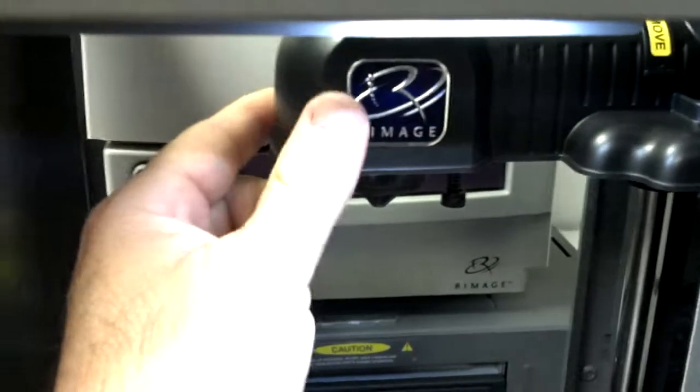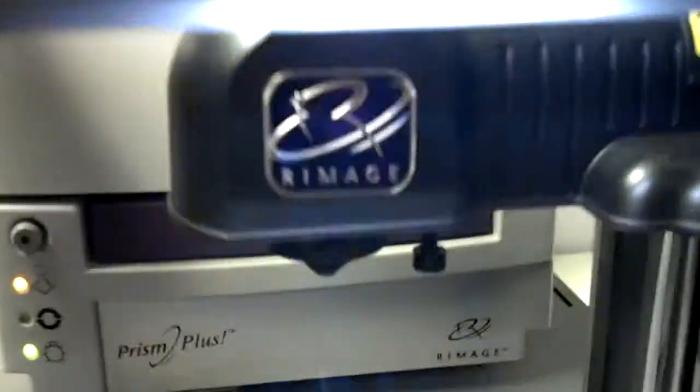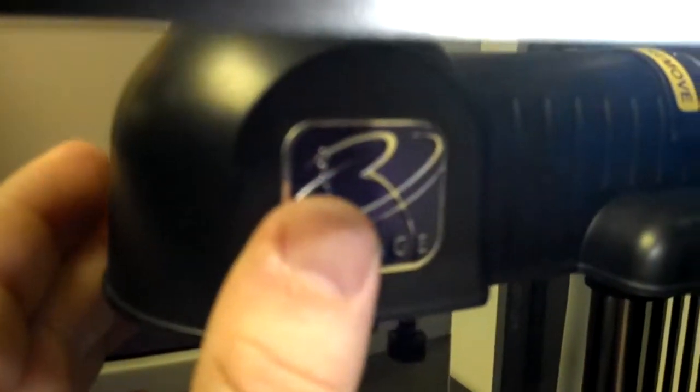The gripper can be swung towards you or towards the printer. The way to adjust this is the silver screw right here. You loosen that screw — it's a T10 Torx screw, that's a star-shaped screw. You basically just loosen this screw a little bit and that will let the gripper move side to side. You basically move the gripper in the direction it needs to go.